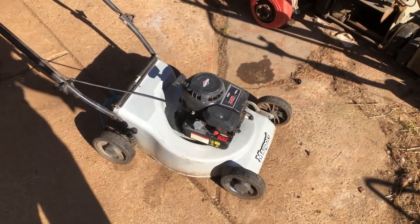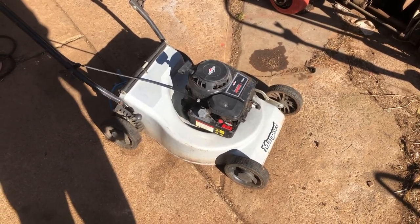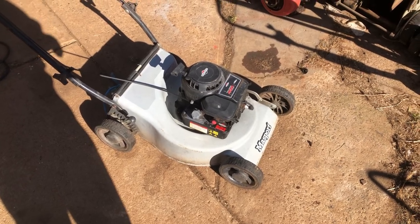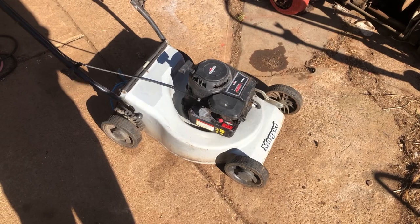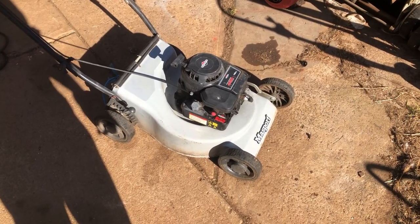So it's a couple of days later. I'm not sure where I'm up to on this video. All of this is just raw footage edited together. So anyhow, what I'm going to do now is take the air filter back off, run it up to sort of running temperature, and then drop the oil out of it. We'll give it an oil change.